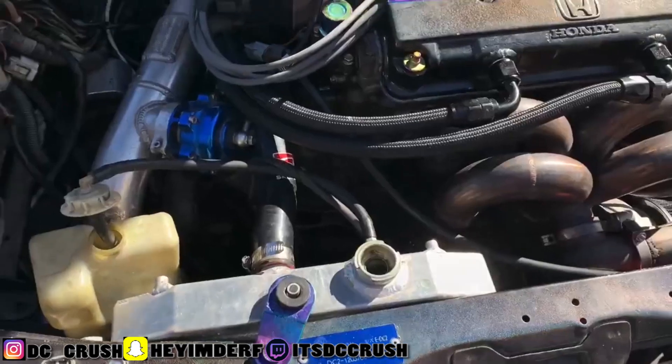I'm gonna use this orange juice bottle to catch coolant. I gotta lift the car up and drain as much as I can. Some will still come out where the thermostat sits, but that's okay. I need to drive to my storage — about a 30-minute drive — so we'll see how she runs without the thermostat. Before that, I'm also going to put the thermostat in a pot on the stove, do a time-lapse, and see if it even opens, because it could be a faulty part from AutoZone.